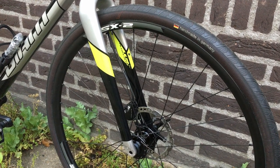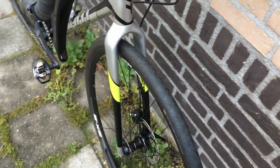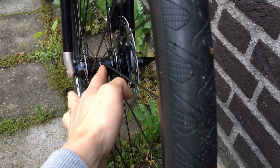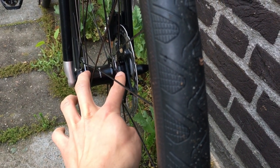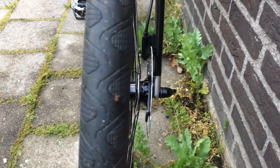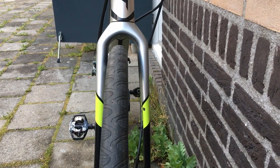I was very happy because everything works — till the moment I realized I messed up. I don't know why I didn't think about it before: I took the distance from this bolt to the middle, thinking that this is the middle of the axis, which is true because it's where the spokes rest. However, you need to consider the distance from here to here, not from here to here. So, back to the drawing bench.